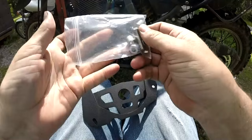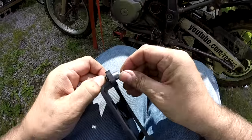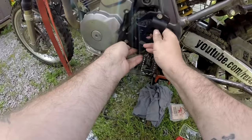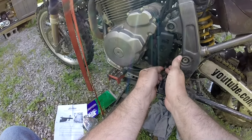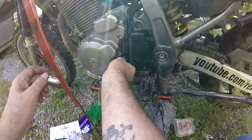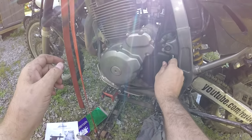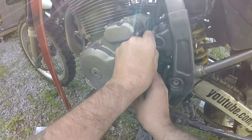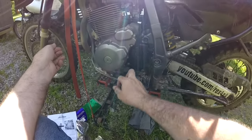We want to make the picture look like that — no more than a quarter inch of threads sticking out past the retaining washer. If you have a 16-tooth sprocket, you want to put the bottom bolts in first, loosely, just so it fits, and then stick your top one in — gives you a little extra wiggle room. Because I'm only running a 14-tooth, I've got tons of room to get these things in there. All right, they're loosely in there — let's get them tightened down.